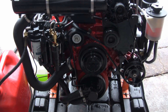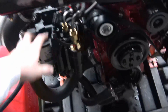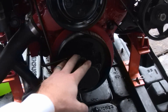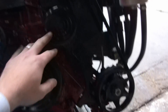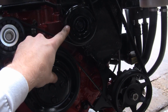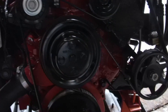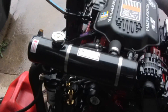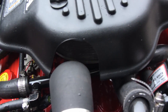Here's the finished product — your 5.7 GXI-J all put back together. You can see you've got the new fuel pump on here, the new idler pulley. I didn't have to get you a new crank-driven sea water pump — just changed the impeller, it was clean. Your pulleys — power steering pump pulley, circ pump pulley, this idler pulley — I was able to just sandblast those and clean everything up. No reason to replace all that stuff. New alternator, your fresh water cooling kit installed. That cuts your shroud out so it fits — looks just like a factory cut.